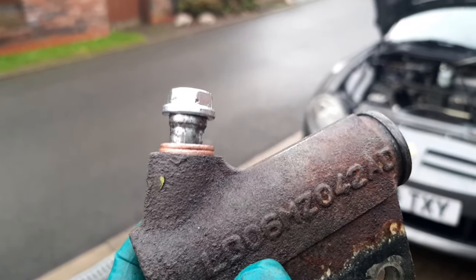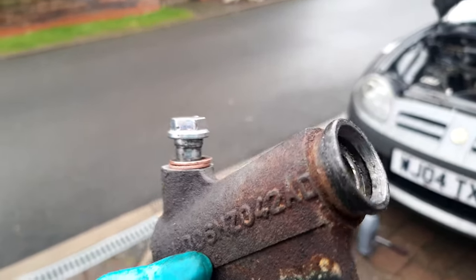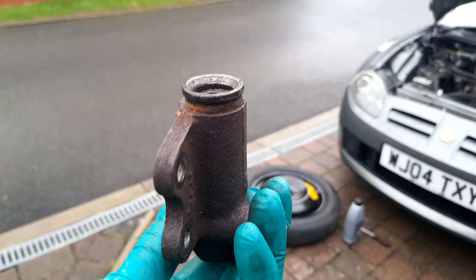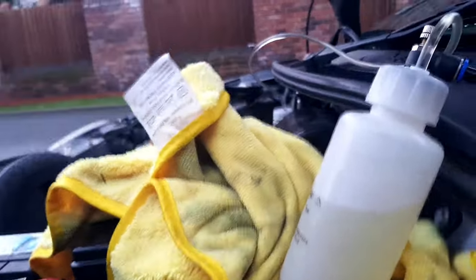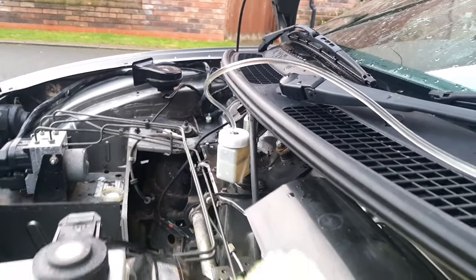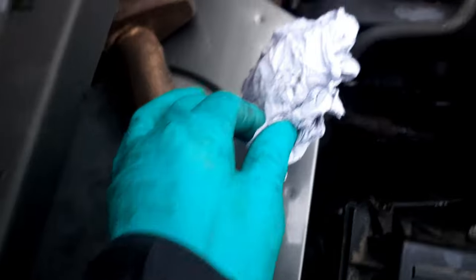It's hard to see, but I'm not sure how square that is — by hand it might be good enough. Pop it back in and give it a try. If that doesn't work, I think we might be on to a new slave cylinder — and looking at the state of it, that might not be such a bad thing. Put that back on, re-tighten. Let's put some tissue under it, pressurize it, and check it's not leaking. Tissue's under there, the bottle's full — let's bang some pressure on. There's a little bit of a leak on top of the reservoir, but it's not going down any great deal and the pressure is on. Pulling the tissue out — it's dry. Oh, I think we've done it.